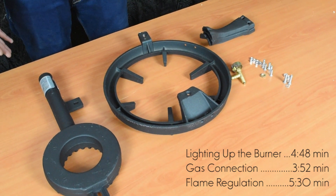While you have been assembling the appliance, you may have disadjusted the metal ring, which is for the correct airflow and the correct combustion of the appliance. You need to place it at the correct position in order to light the appliance safely.